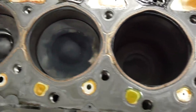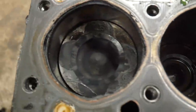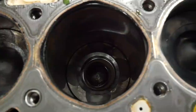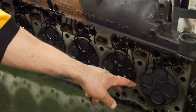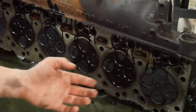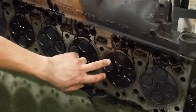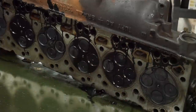I can already see an issue. The cylinder walls look nice, so that's good. Diesels have a very strange combustion chamber — it's actually in the piston. But that piston and that piston appear to have struck the cylinder head; they have an outline of what the bottom of the head looks like. The only way that happens — because you can't really make a rod longer — is if you give it some play, like not having rod bearings. I think we're onto something. Looking at the cylinder head on the workbench, there's a distinct contact line all the way around the surface of the head and the valves on two cylinders, with oil everywhere. The rest of them look pretty normal. This tells a story of what we're going to find in the bottom end.